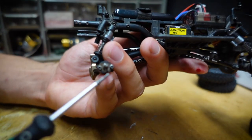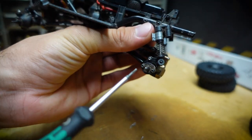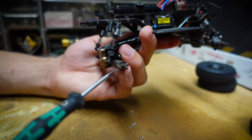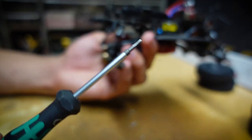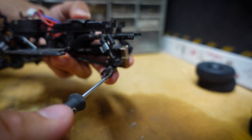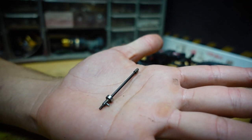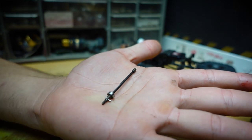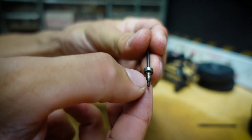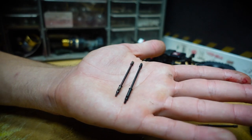Now for the easy part. There are two screws on the rear axle - one on each side - and you have to undo those two to get to the inner workings of the rear axle. There is the stock axle out of the truck. We're going to first remove the pin, set that to the side, then remove the bearing - keep that. Put the old axle to the side for the parts bin.